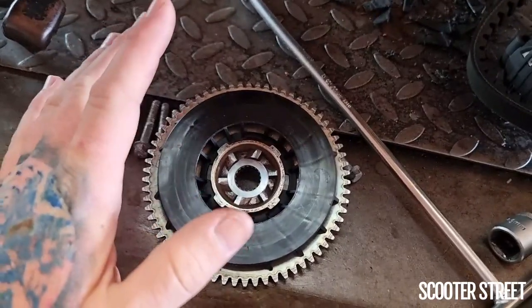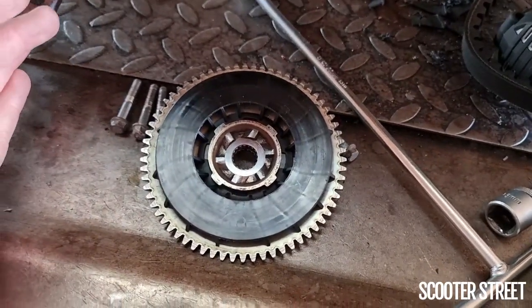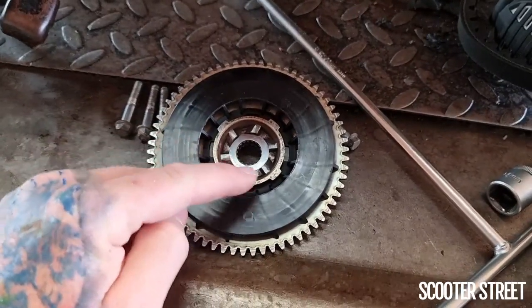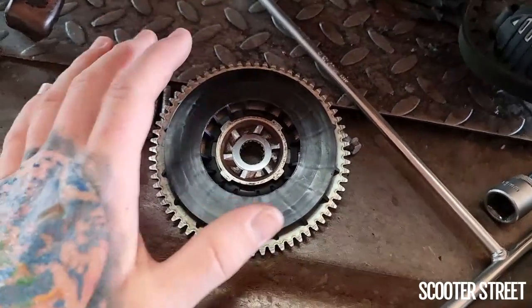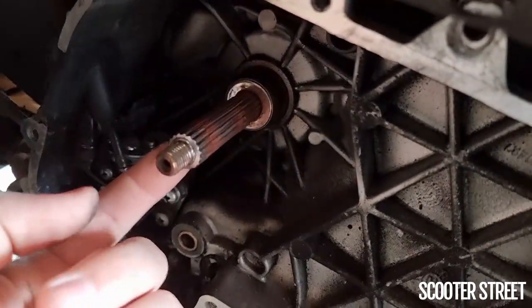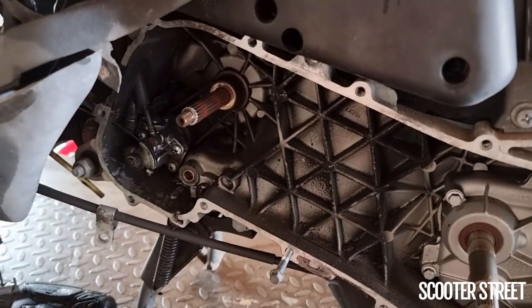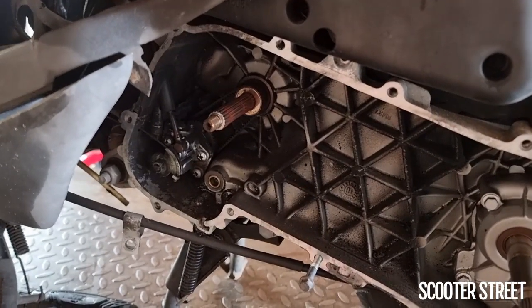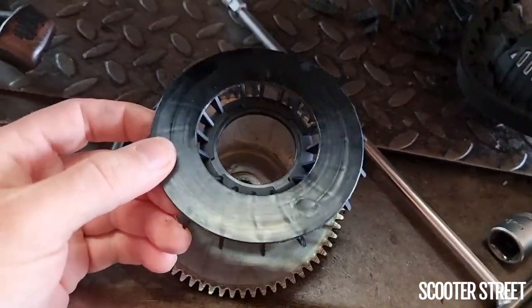This becomes really hazardous, particularly because the fan is only going to blow apart when you're riding, so you're going to be at RPM when this happens. Unfortunately what we have seen a couple of times — recently I actually saw this — the fan plastic came apart, and that additional space for that momentary bit of time was enough to essentially blow the transmission apart. All of a sudden it had additional movement, stripped the spline on the end of the crank, which is required for the transmission to lock onto the bike and get drive. That scooter ended up needing a replacement crankshaft — a really expensive job. For the sake of something like $12, it can be a very expensive and costly mistake.